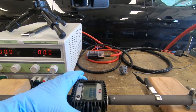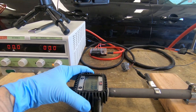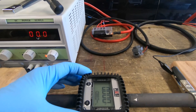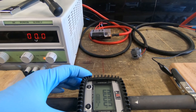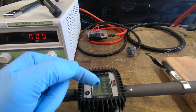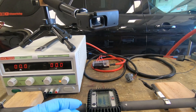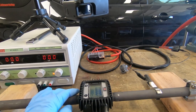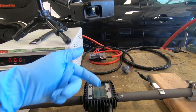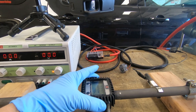The next thing we're testing is fuel flow. There's a lot of equipment out there to test flow of various fluids. I found something cost-effective — about $140 — but it will not give me a direct number like liters per minute or gallons per hour. The way I'm going to measure actual flow within time is by filming, taking 30-second time slices, then using video editing software and math to calculate the flow rate.